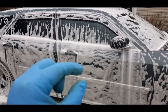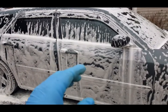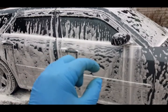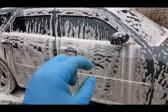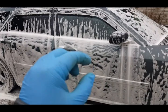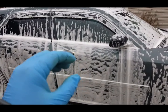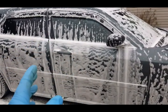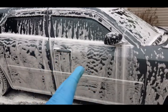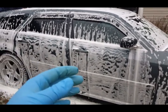MJJC foam cannon, and I saw what the foam was like. Then I left the 1.1 orifice in, but I went back to the original mesh foam maker that came with that foam cannon, and it produced better foam. The reason I say that is because that also plays a part. Changing from a 1.25 to a 1.1 orifice should enhance your results. You should have better foam, no doubt. But I'm just telling you what I saw.